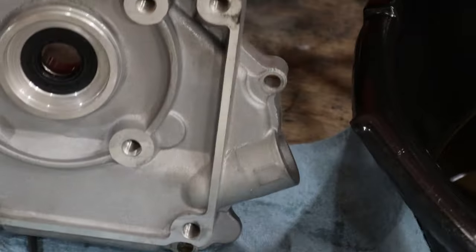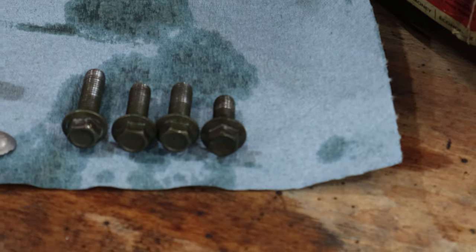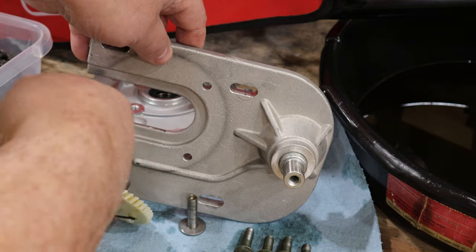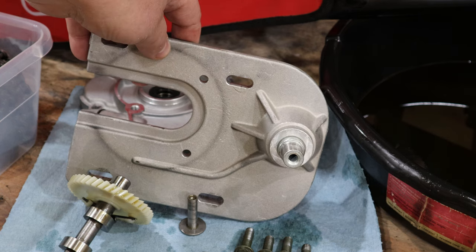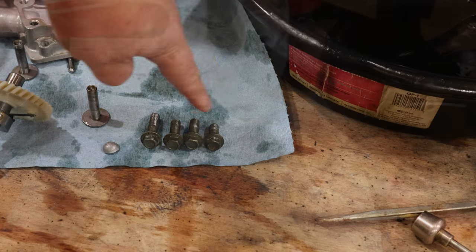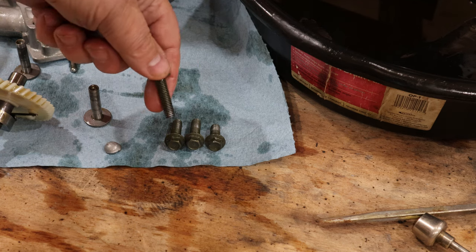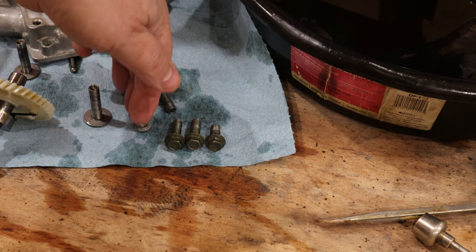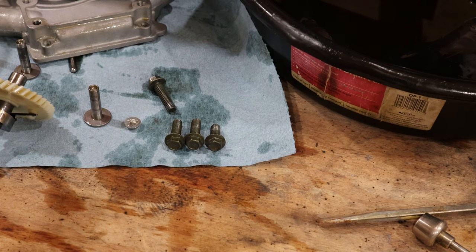And when the bolts are too long, so there's four bolts that hold this. So this is, let's call it, the jack shaft plate, because you've got your main drive sprocket here, and a jack shaft here with a bigger sprocket that goes down to the wheel. And it's the same thickness all the way around, yet four different length bolts here. Why? I have no idea. Obviously, this one was too long, and when they tightened it up with their little impacts at the factory, or however they do it, they popped that out, which caused that to float around inside this crankcase.